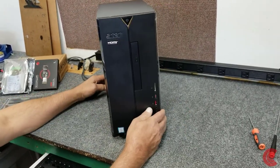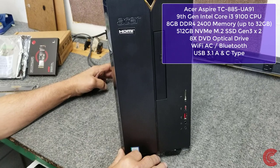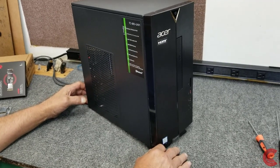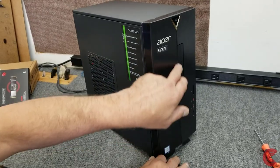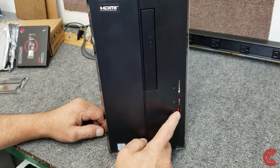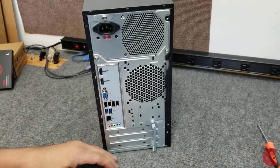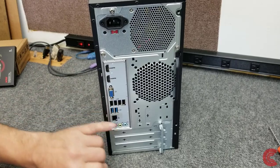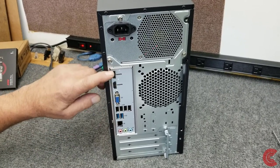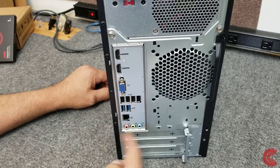So here's the new Acer desktop, it's not a bad little computer. It's got a 9th Gen Core i3, ships with 8GB of DDR4, a 512GB PCI Express SSD, an optical drive, an up-front SD card slot, USB 3.1 up front — both A and C type — audio jacks, and a power button. On the back: dual HDMI, a VGA port, four USB 2.0s, two USB 3.0s, so it's got a lot of USB ports. You can hook up three monitors to this. It's got Ethernet, built-in dual-band Wi-Fi, AC wireless, and of course audio jacks.